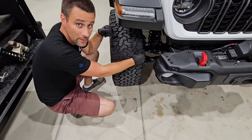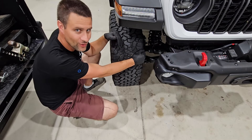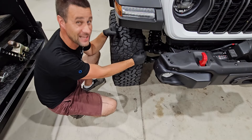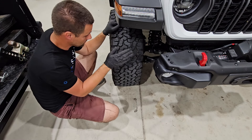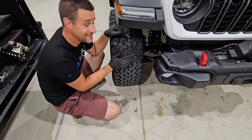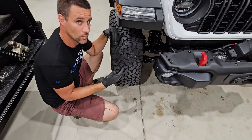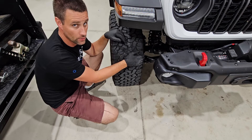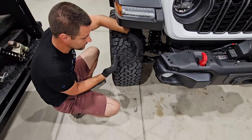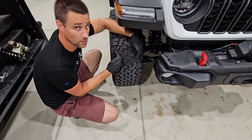You want the tires cool when doing this test, because as a tire gets hot, the pressure increases. Do this test after the vehicle has been sitting overnight so you start with a nice cool tire. What I found gave really nice, even wear all the way across the tire was 30 PSI cold — quite a large difference from the factory 37 PSI on the door jamb.